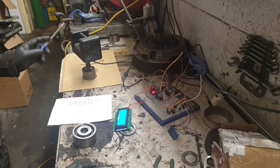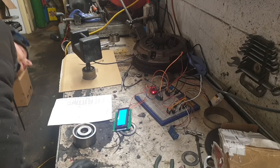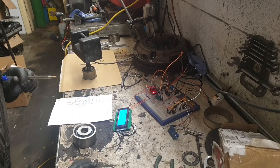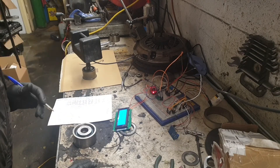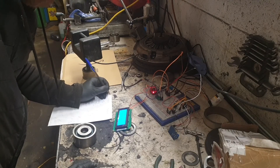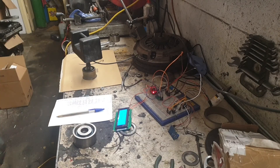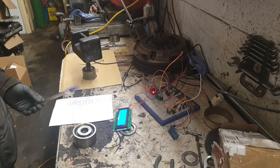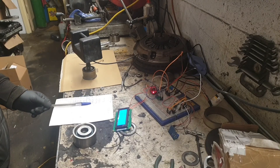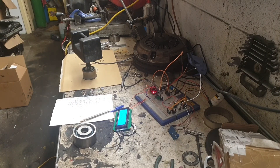Just for the hell of it, I thought I'd do a calibration. I've got my calibrated weight out — it's a decent standard, not the best but close enough. A five kilo weight is roughly 50 on the force reading — I don't know how I managed that but I'll take it. So it's literally just knock the end number off and that's your kilos. So about 200 kilos it took to open the clutch. Nice.